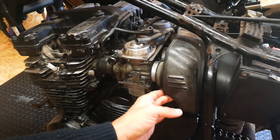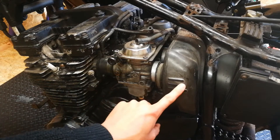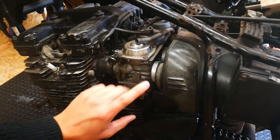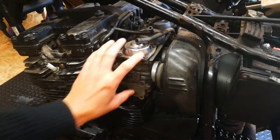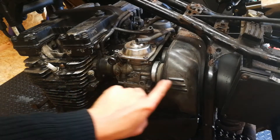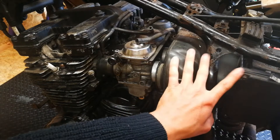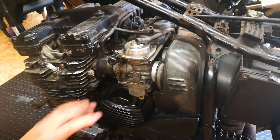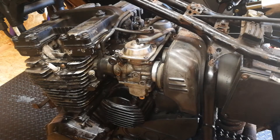This airbox, I think, is going to get in the way. Whether it does or whether it doesn't, I'm going to take the carbs off and pull them this way. They should just hopefully slide out, because this box will only go that way — so the airbox won't come out that way. As you can see, it's restricted by the frame and it's not actually in two parts. So I'm going to take these carbs off, slide them this way, and hopefully then I can get the airbox out. Right, let's give it a go.